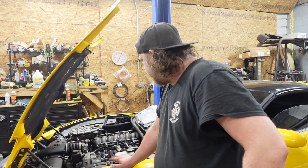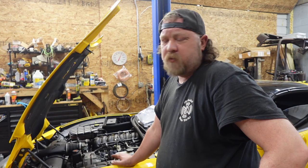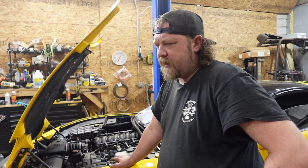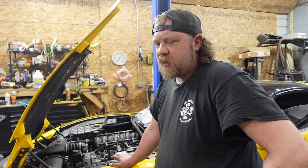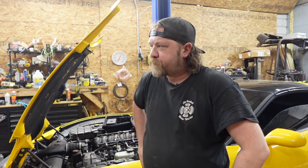The other thing, I crawled under the car again, looking at the seal, obviously. The rear main is dry. There's nothing coming out of that. The cover plate, though, if you don't know, on an LS they have a plate that bolts on and has the rear main in it. It has a gasket around it. That could be leaking, the actual perimeter gasket.